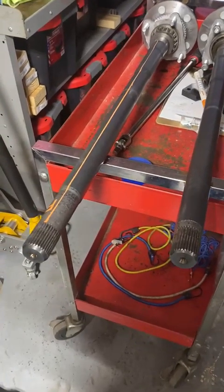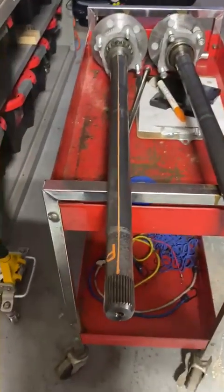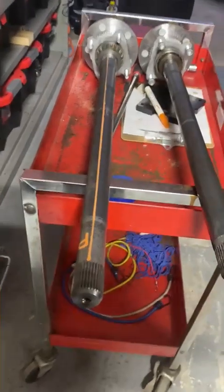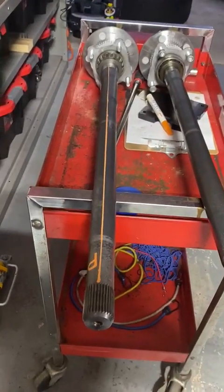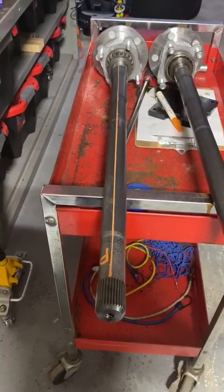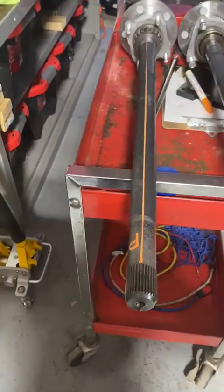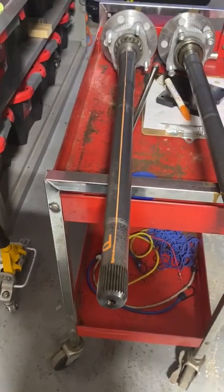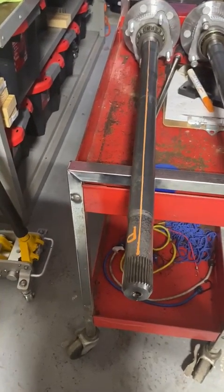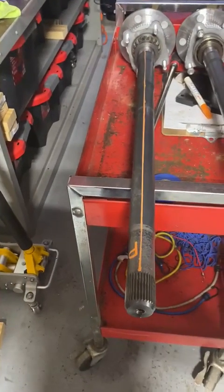These are not. So, as far as drawing lines on the axle shaft, this is something that's been done for a long time in the racing community, even the off-road community. It's just a really easy way to inspect your shafts, and it's not always just the splines from the engagement point out on the spider gear that twists. The shaft will twist too if you're not careful, or you may never see it. Most of the time it breaks on this end anyway,